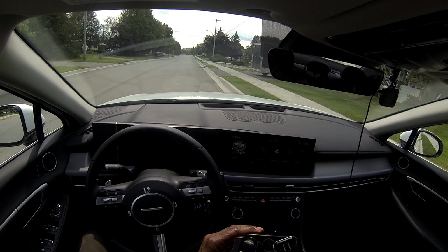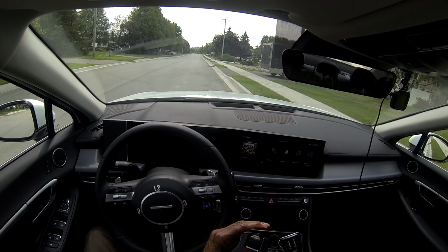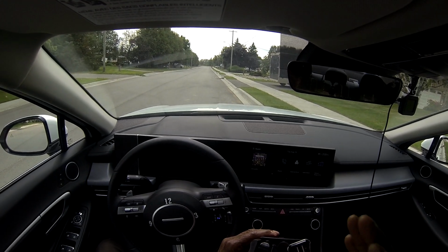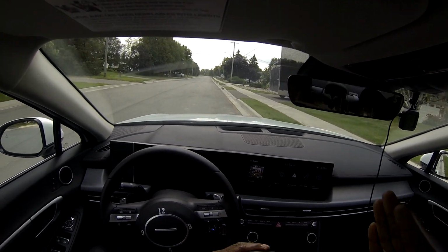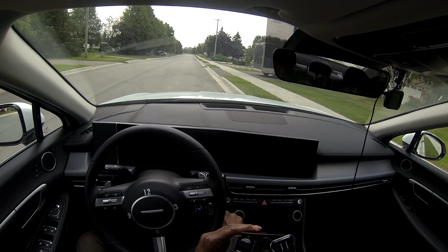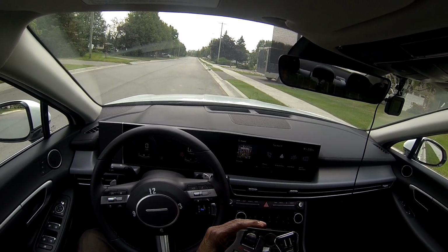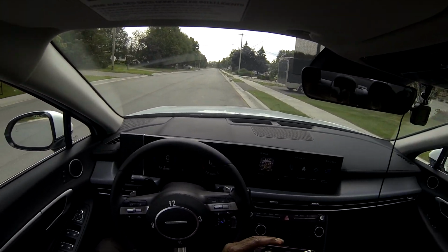Now I'm going to start the car again, and we'll see what happens. Because see, it's basically steady. It's saying 12.6, 12.9. So if it goes up to 12.7 or 12.8 or 13 when I start, it simply means that the alternator is charging the battery. So now I'm going to start the car. Alright, you see 13, 13.7, 13.8. So you know that the alternator is working. So you have no problems.